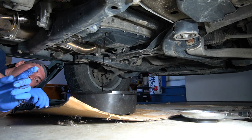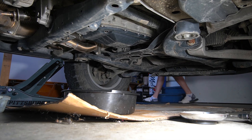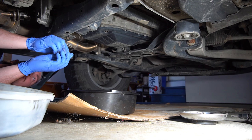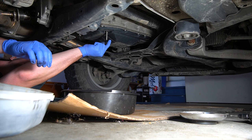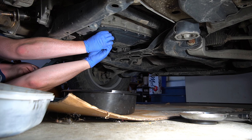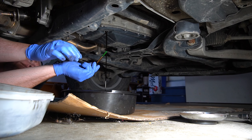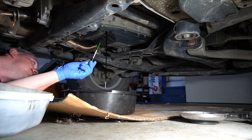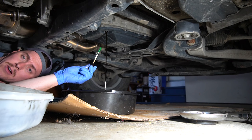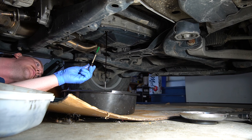It's almost at a dribble, so we can pull the inner plug out. I'm going to grab our extended five mil — sorry for any hammering noise in the background. Things are probably going to get a little messy here. We're going to shove this up in there, twist, and it should come out by hand — it's this little green plug. We're going to start flowing a lot faster because we've got about eight liters in here, and I honestly don't know what the capacity of the catch pan is, so things might get interesting.